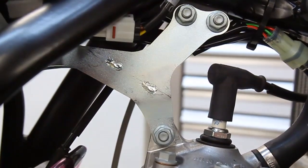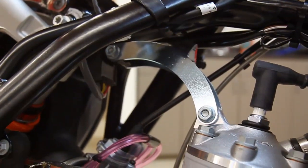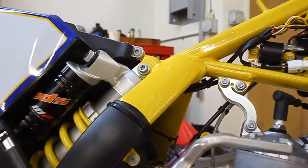If you think all that shock tower stuff is crazy, all you have to do is take a look at the head stays on these bikes — it shows just how much additional tuning goes into controlling the flex and chassis character of these motorcycles. Engineers, we are not. But in theory, what KTM has done with their newer frame systems is to isolate the amount of shock force you're going to feel — that force gets transferred up the backbone of the frame and you end up feeling it in the handlebars, and they're trying to lessen that sensation. The other advantage of the new frames is they've given, especially on the PDS, a little bit more shock length which helps control the shock stroke. On the XC, which has the linkage, they can throw a little bit more progressive kick in there so they have even more control.